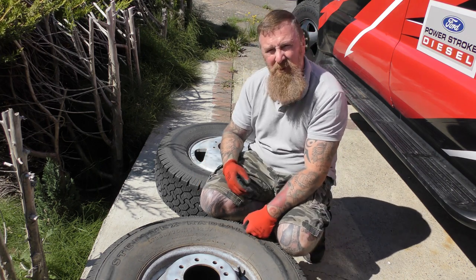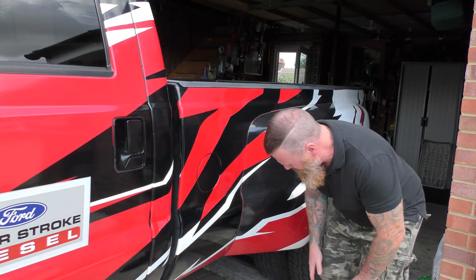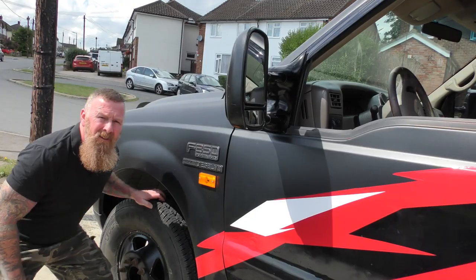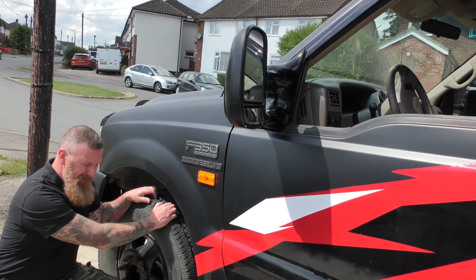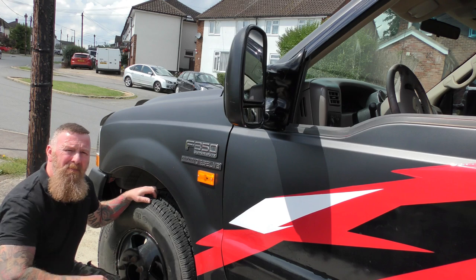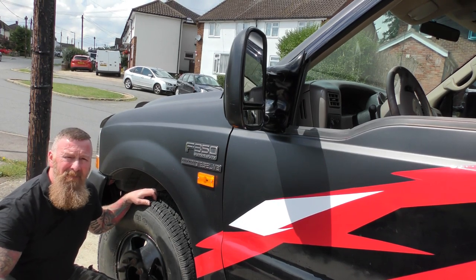All back on again — all good plans, ha, ain't gonna work is it. Hopped to the garage, got the two front ones, put them on the back, swapped the tyres over. That means now I've got the 265 by 65 by 16s on the front — matching at the back, matching at the front — and it's not throwing the ABS sensor out or anything, so job done.